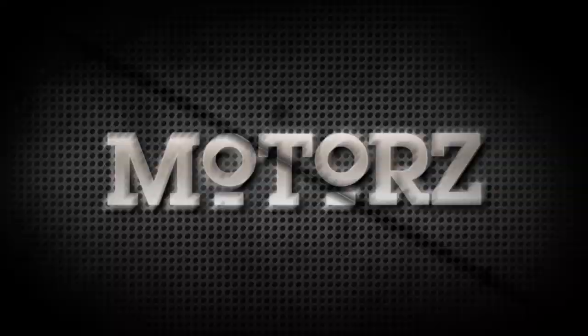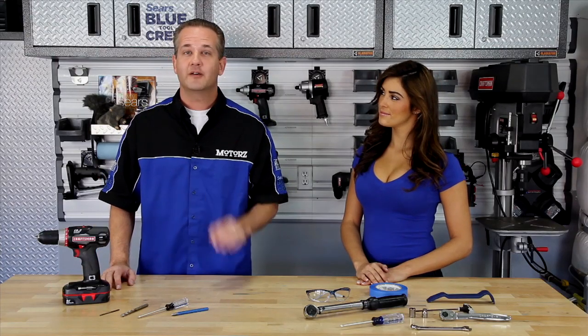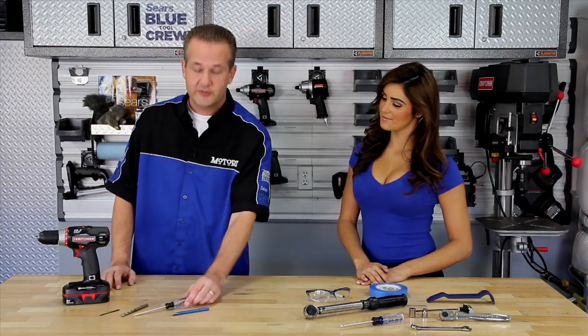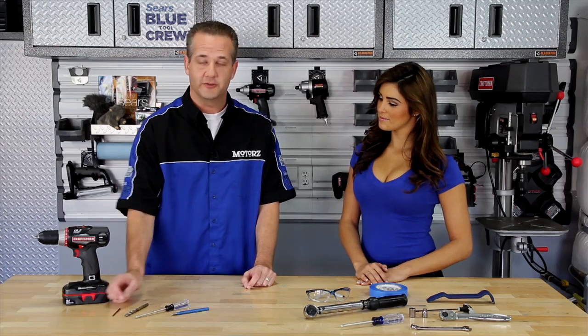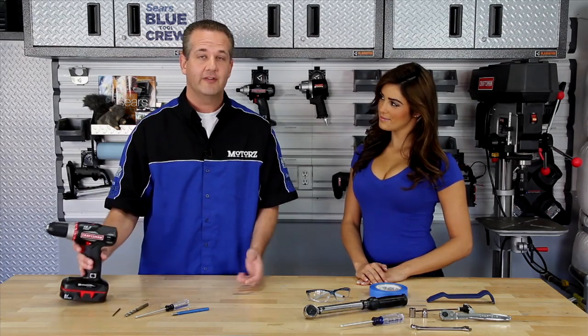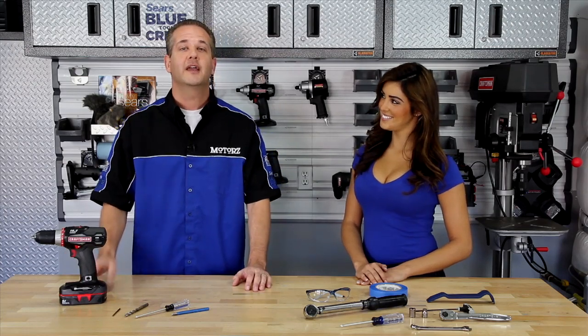You're good to go. The tools you're going to need to install the BedXTender HD are ones you probably already have. We've got a center punch, a Torx T25 driver, a 21/64 drill bit, as well as a 1/8 drill bit. Of course, you're also going to need a drill. Everything else is pretty basic, and if you don't have it, you can head on down to your local Sears store, and the Blue Tool crew can hook you up.